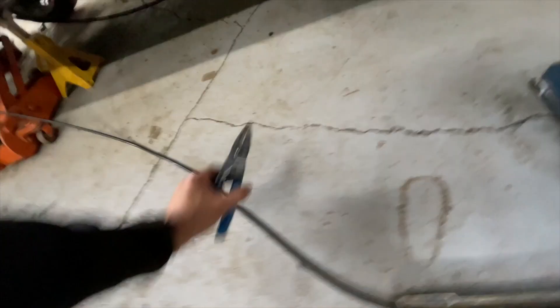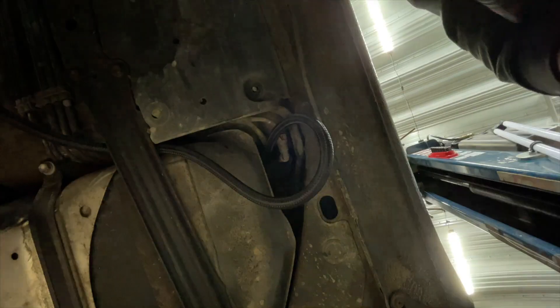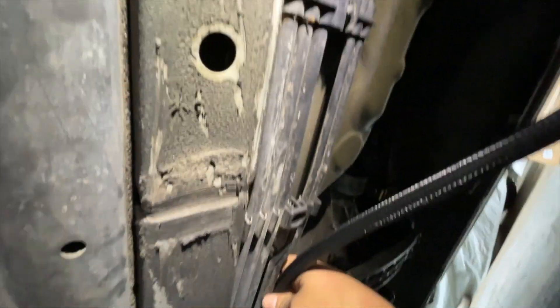I've got it punched into the tank now. Basically what you want to do here is follow these lines — we're going to zip tie them to the lines right here all the way through. I've got this fed all the way through, so we're just going to zip tie them right next to them. Once it's zip tied up here to get into the tank, you want to go over this bracket here — there's a gap right there. If you shove the hose up there you'll be able to grab it from there, and then we'll zip tie it to the rest of the lines.